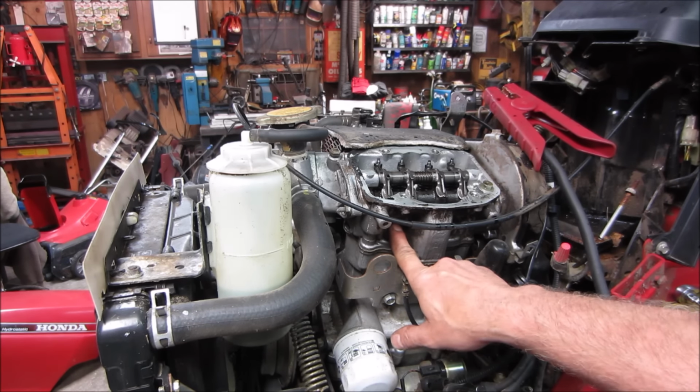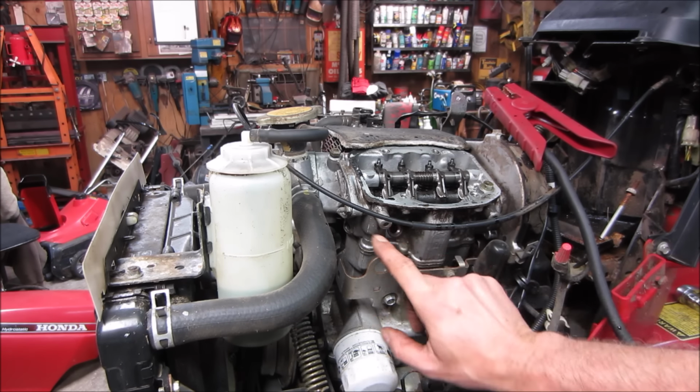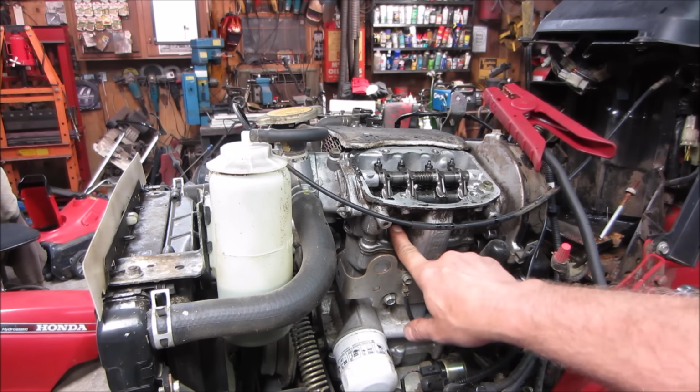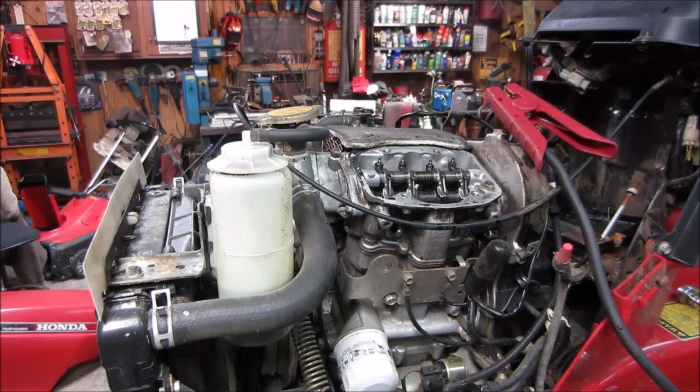When I had my finger over there, it was pulling my finger in. It should be with a pop, trying to pop your finger off the hole. But instead, you can actually feel like a vacuum trying to draw it in, and that wasn't correct. That's how I knew there's already something wrong without even bothering going to a compression tester, because it's just not going to show anything. There's nothing there.